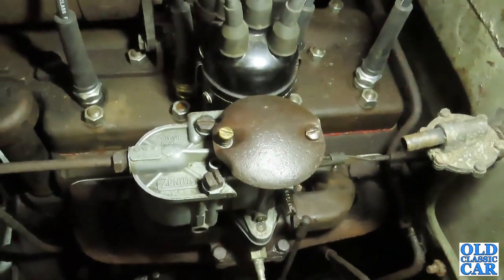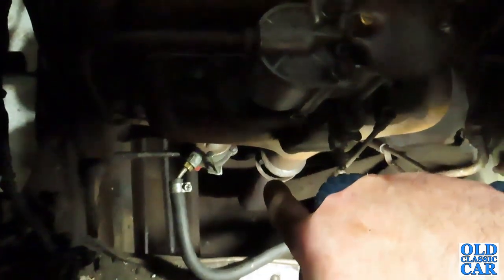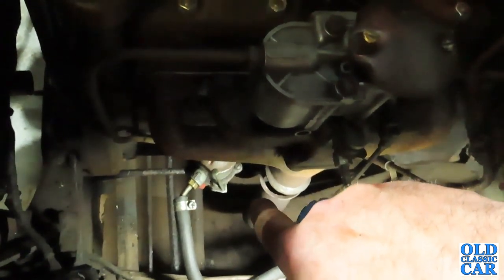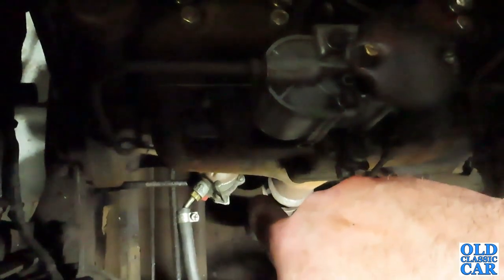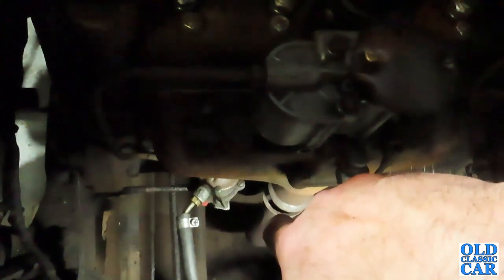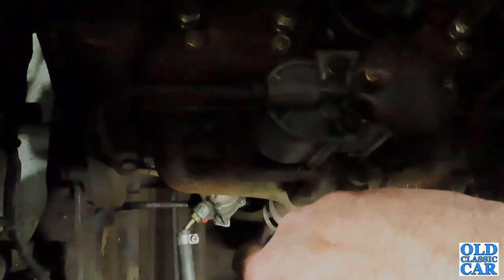And then we can move on to refitting the exhaust clamps and hopefully trying to get a decent seal on the exhaust down there. I've still got the jack underneath, so I can lift up the downpipe gently on the jack and get it all lined up and under some compression before I put the bracket on, and then hopefully with a tiny smidge of exhaust sealant it will actually seal up okay. So that'll probably be the next job to do.